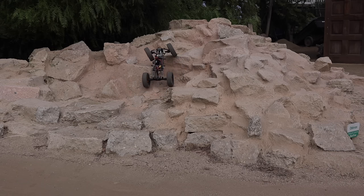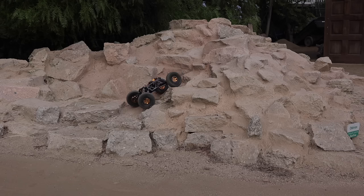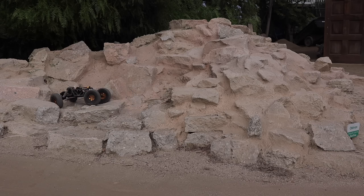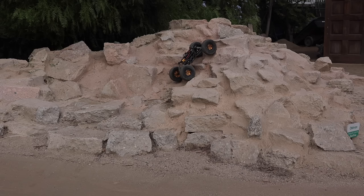Like I am noticing the drop in torque. Why is there a drop in torque, you ask? I had to use like 50% throttle through there because even with drag brake disabled, now that we've been wheeling for 15 minutes, the motor's pretty hot. You have to be able to hear that stutter at low speed. Like right here, nothing. I'm at 40. Like the first 40% of throttle, I don't get anything. It's just there's so much mechanical load on the motor. And then right here, I need to slow creep it, and I can't.